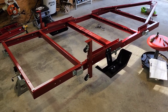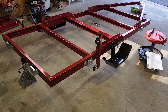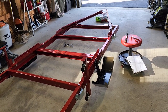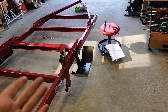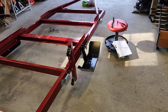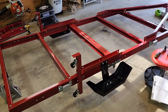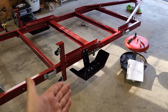The fenders are on. One thing they don't tell you is that for a lot of the stuff you got to do when this thing's flipped over - mine's been flipped over the whole time - you got to lift this thing up. You got to have something to prop it on. Without something to prop it on, like a jack stand, your fenders are just going to be smashed into the concrete trying to support it to get this stuff on. I almost feel like you could have done the fenders last, or take the wheel off. Just keep in mind you have to prop the trailer up to get it in the air so the fenders aren't smashed onto the concrete.